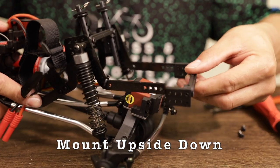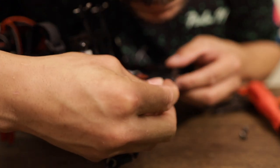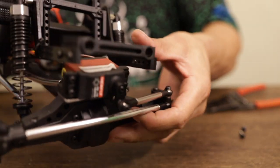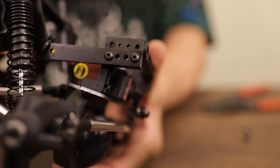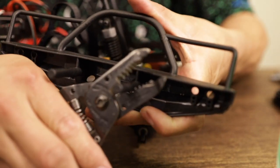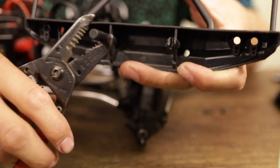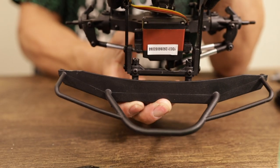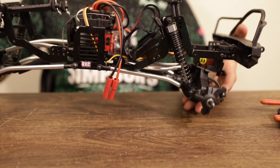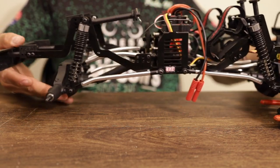So what we ended up doing was mounting the bumper mount upside down. If you notice here, that bumper mount — although it is just switched upside down for some better ground clearance — it is still colliding with the servo a little bit on the sides and the servo horn. So I had to do a little more modifying and got my Dremel out and took away some of that material up front where it was colliding with the servo horn. We get so much more movement out of there now. Another big deal was these little bars — the little mounting brackets that slide through your bumper mount — those were hitting the servo as well. So I just clipped those off and now we get the full potential, full travel with no obstructions whatsoever. The servo horn just slides perfectly inside the area that I ground down, and we should have a little bit more ground clearance.